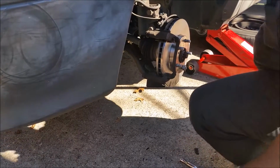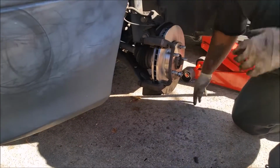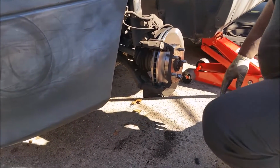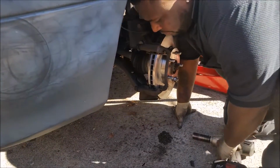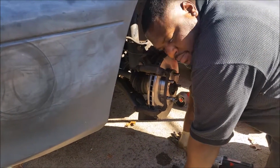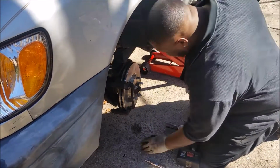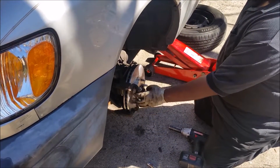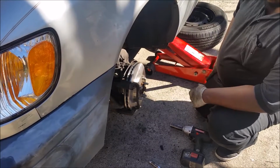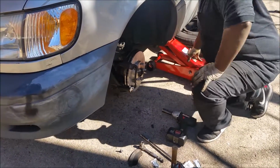Okay. So now, what are you looking for? Well, I'm looking at the rotor, it's very close to the brake. I see the rotor is touching the actual caliper bracket. That's not good. A lot of times when that happens, you normally have the wrong size rotor, so that's why I was double checking. But it's the same size, correct? Yeah, it's the same size. Once you tighten down and put the wheel on, nothing's touching anything.